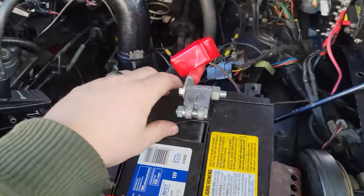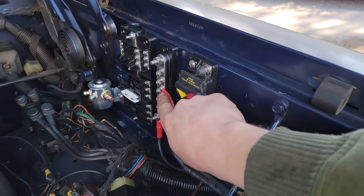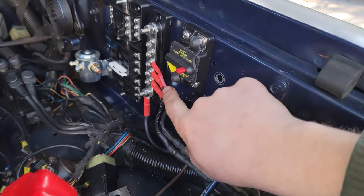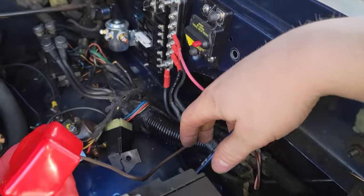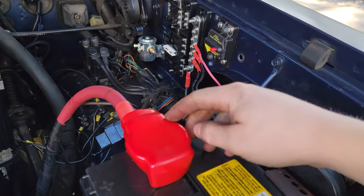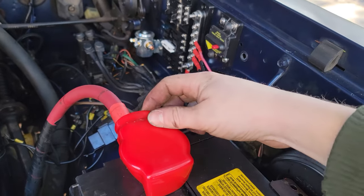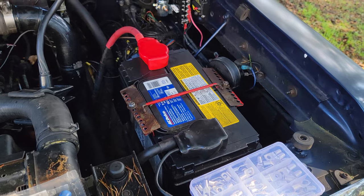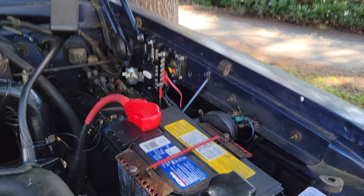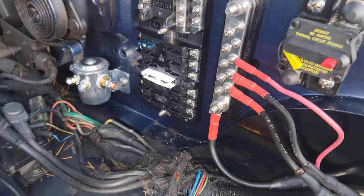That's all there really is to installing these battery terminals. What I'm doing with my factory wires is running them to this positive bus bar and through this circuit breaker, so I can shut off all 12-volt power to the truck if I want to — this is the main circuit breaker for the entire truck. If you choose not to get a positive bus bar, you can just run the circuits to the back or front, keeping in mind you'll need a stud with a three-eighths diameter hole for that back bolt. Both covers will keep everything nice, dry, and corrosion-free. I'll continue wiring the auxiliary fuse block and then show you the finished product.